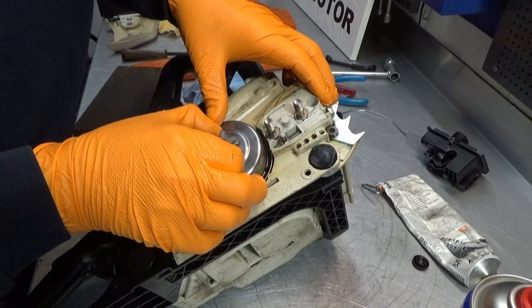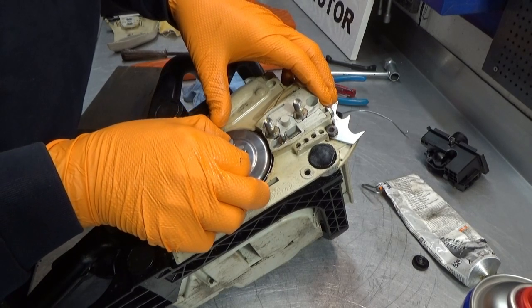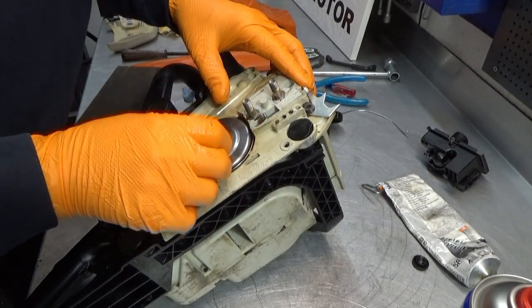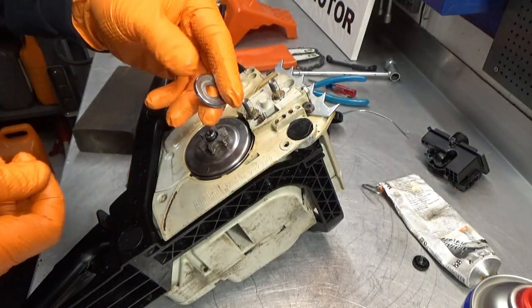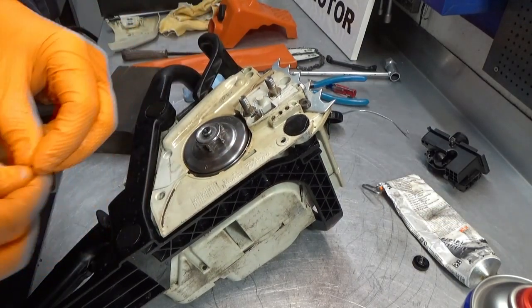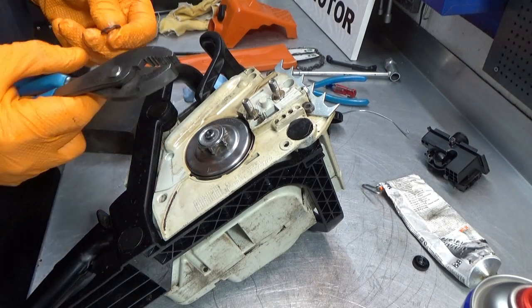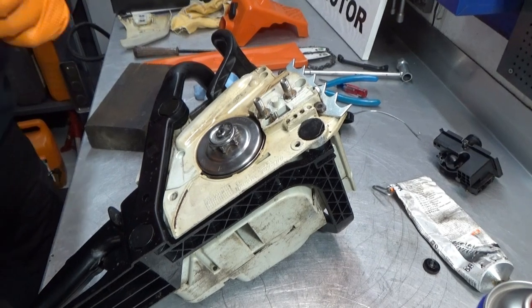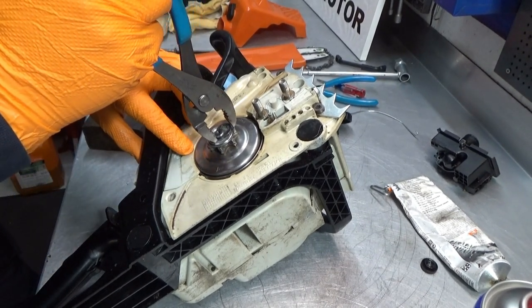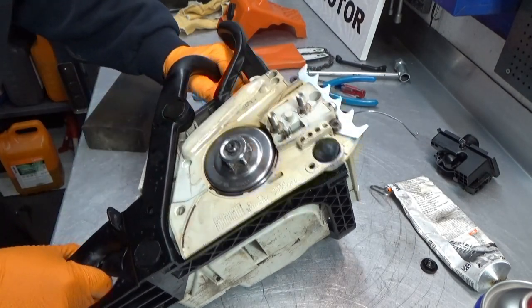Just going to release the brake here. Where are we? There we are. Did we get it? Yeah, we did. Alrighty. We now have, on these cupped washers, it goes here, and this little C-clip, E-clip, whatever it's called, be careful, they tend to want to get away from you, and it's one of those things, if it lands on the shop floor, it's gone forever. Okay, clutch drum is in, that's good.